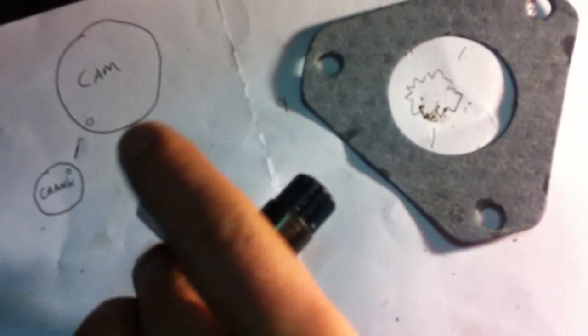Past that, for more in-depth timing, you've actually got a little plate here which gives you TDC, 20 degrees before TDC, etc. So the only other thing you've really got to time is your injector pump. This is what your injector pump spigot looks like.